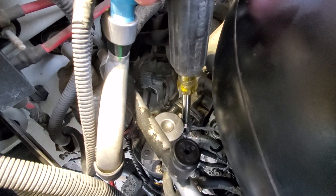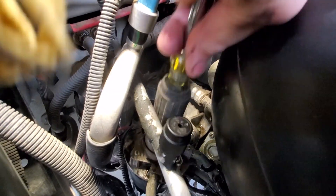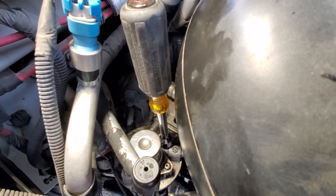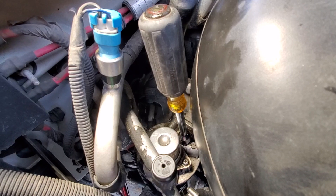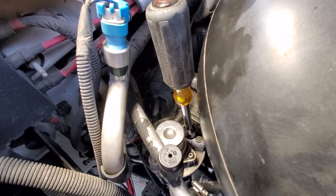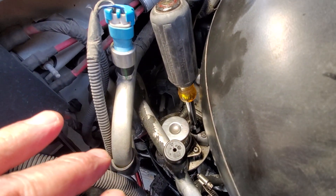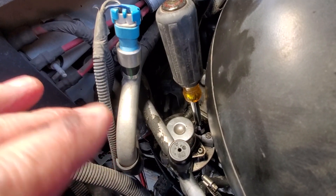You're seeing a good flow now. Keep pumping and relieving pressure — the goal is to get all those air bubbles out. What can happen is if it's not primed all the way, you start your truck, it'll idle for a couple minutes and then die. You have to get out and reprime it — that's an air bubble that sucked through. Once you see a nice solid stream, you're good to go.